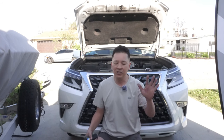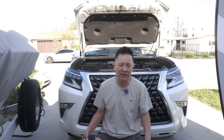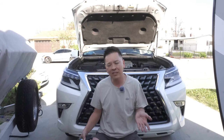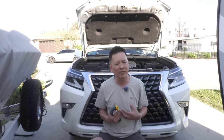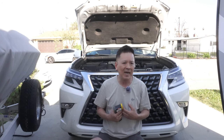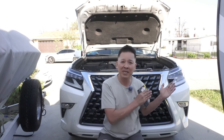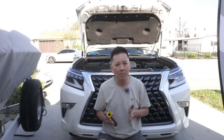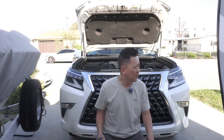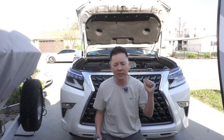For those that have asked me what was the best mod that was cheapest and gave the best ROI, I would have to say it was my Hayden external transmission cooler. Now, if you're not towing anything and you're just doing normal daily driving — shopping mall, work, mountains — you really don't need an external transmission cooler. It's for people towing travel trailers, toy haulers, and boats like me. It gives me a lot of confidence that I am protecting probably the second most expensive component on this truck aside from the engine itself, and it only cost me 50 bucks.